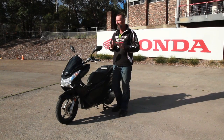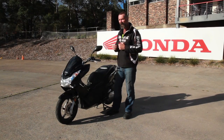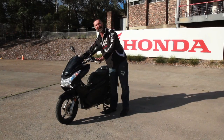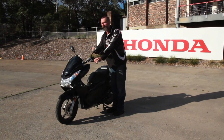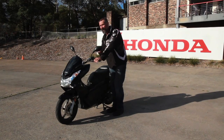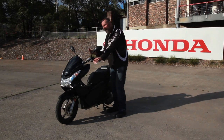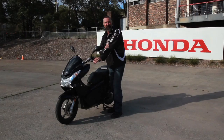The other thing we looked at is motor-assisted pushing of the bike. If we're going to do this, we do need to be very careful. The major points are: keep your right wrist nice and low so we don't over-accelerate, control the speed with a little bit of rear brake as we're accelerating, keep your head up for balance, always look where you want the scooter to go, and keep it leant slightly towards you. I hope these tips help — if you need any more help, come and see us at HEART. Safe riding.